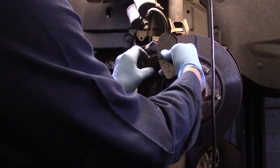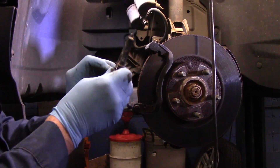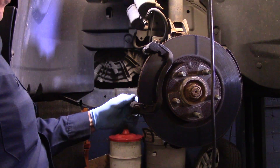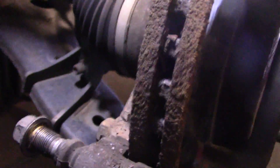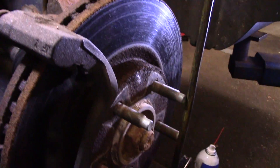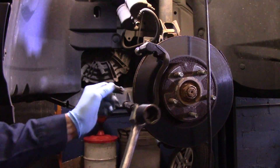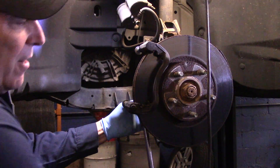We're going to take our brake pads out. You don't have to do this step now — you could do this later on, it's not a big deal. We're just going to put them to the side. If you're not sure you'll remember where these go, just stick them back where you took them out of so you know they're in the correct location. Next, we're going to come up underneath here — you see these two bolts here — we're going to break them loose and take this mounting bracket off the truck and bring it over to the side bench. These work pretty tight back here so we're going to use a breaker bar, which gives you more leverage. Or if you have an air gun, you can shoot it off with that.